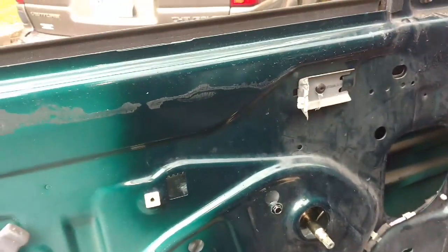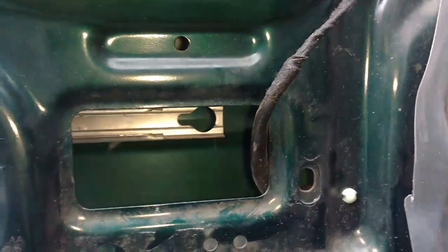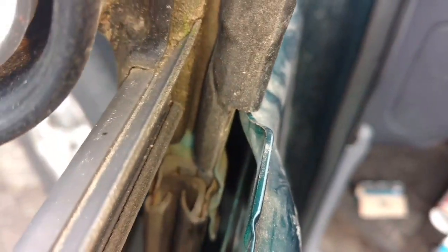Now I'm going to slide the window down there, get it in the track, hook it on those 2 lower portions, secure that. Then I'm going to get this track back in on the front side of the window. Clips in there, and then screw it here where it goes there. Easy to look down there, get that track in place, put it in position, put it there.